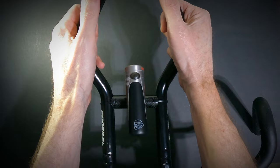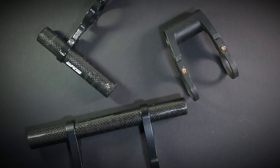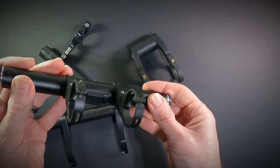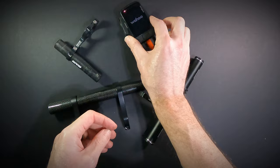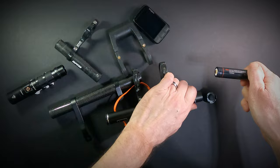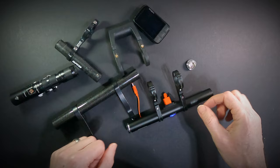In the previous hack, one option was to repurpose an accessory bar — but for this hack, we actually want an accessory bar. Over the years I've built quite a collection, but recently found what may be the ultimate accessory bar for long rides. This accessory bar is also a power bank, meaning I can run a short USB cable to my GPS and keep it powered up without using any precious bag space. The bar uses two rechargeable 18650 batteries, and my favorite helmet light, the Fenix LD30R, uses the same batteries, so I have a backup if needed. As a bonus, the power bank works just fine with one battery. I'll warn you that this is a cheap no-name product from China, but the electronics are quite simple and I've had zero issues with it.